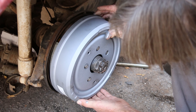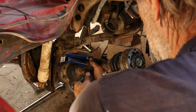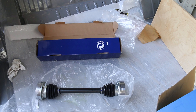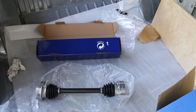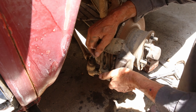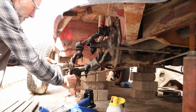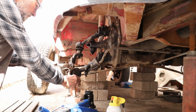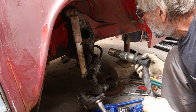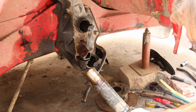First off I had to overhaul the rear brakes — new brake shoes, wheel cylinders and drums. I removed the axle shafts to replace the torn boots, but they showed signs of wear so I bought new ones. The front brakes were all frozen up and it took a while to get them apart. The control arm ball joints were worn so they had to be replaced — the old ones have to be pressed out, so I had to remove the control arms from the bus and take them to a machine shop.